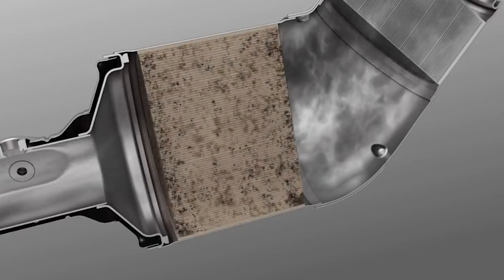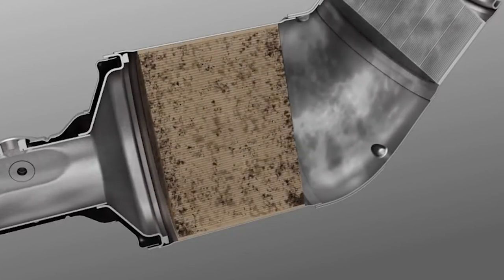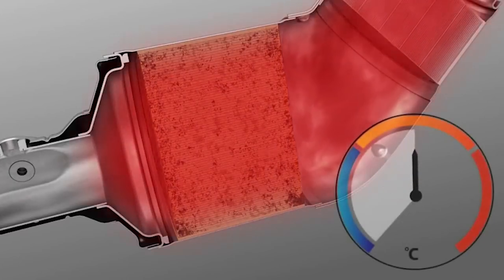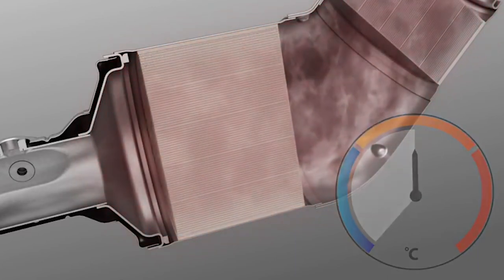This is most common on diesels, predominantly used for short, low-speed journeys, in which case they need a blast down a dual carriageway. For petrols, it happens when they've been used under load, like towing. Find occasions to lift off the throttle and slow using engine braking to clear the filter.